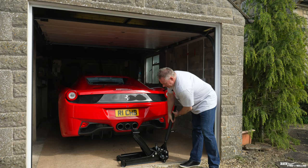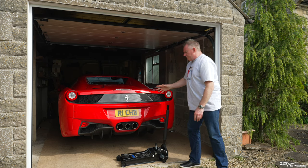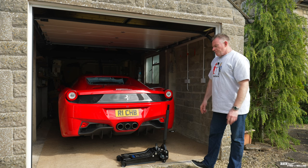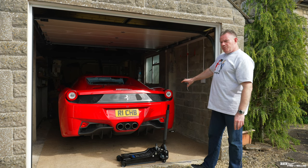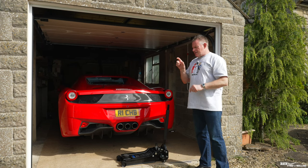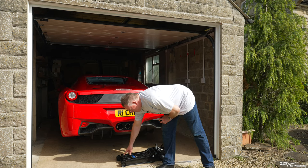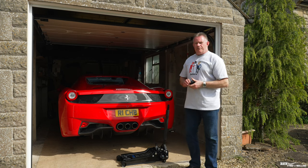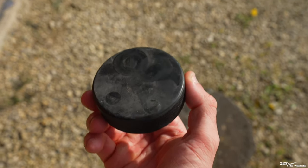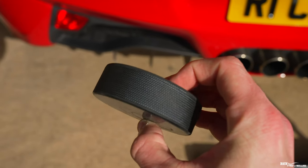It's a low profile jack and it drops very quickly as well. I actually updated my jack to make it easier to lift the 458, given its quite low clearance on the side. Now, the jacking points on the 458 — especially the rear — have a seven and a half centimetre diameter recess. So this is where the ice hockey puck comes in. This is actually an ice hockey puck, and it is exactly seven and a half centimetres in diameter, so it fits perfectly into the jacking recess at the rear of the car.